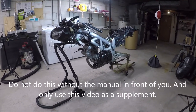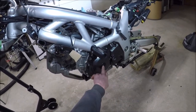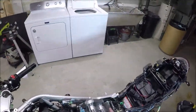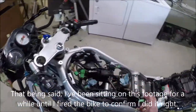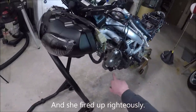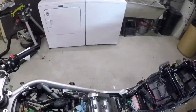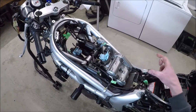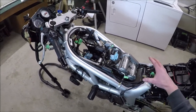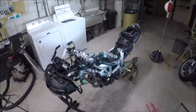So what I am going to need to do is pull off this cover. There's an o-ring behind there as well. I'm going to need to pull off the sight port. I will need to pull out the two spark plugs so that I can freely spin it without building compression. I will need to pull off these three bolts on each of the valve covers. I think the gaskets are going to come with it, and then we will have the cams and chain and everything exposed.